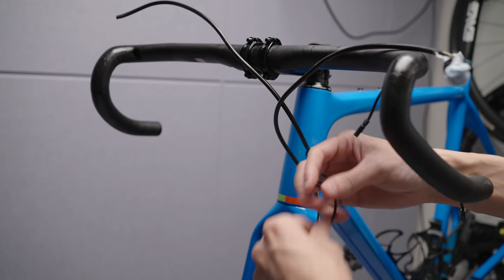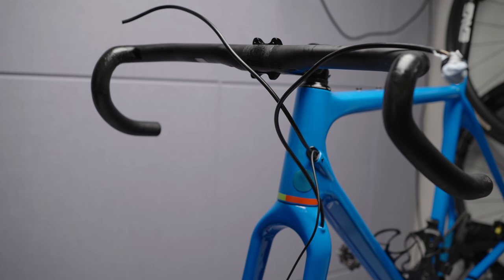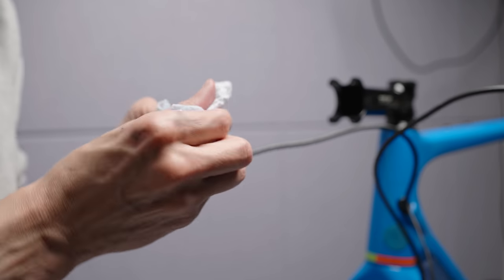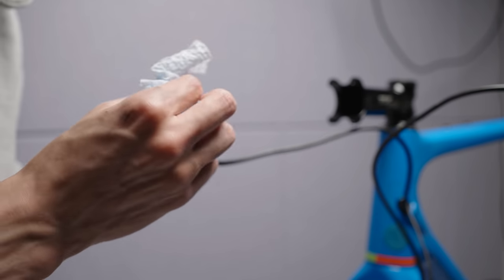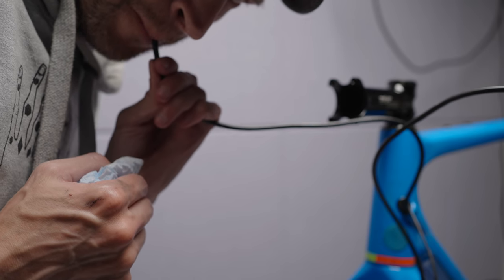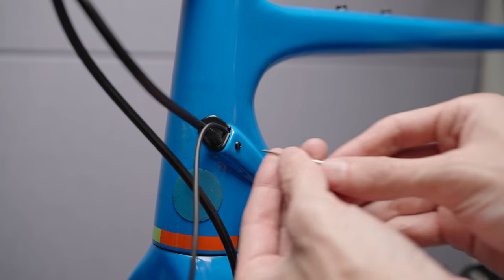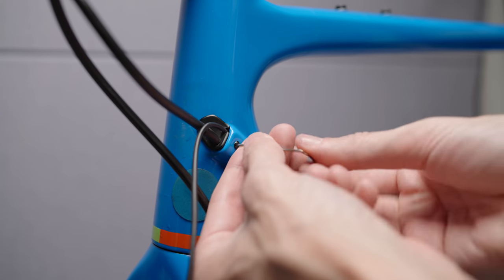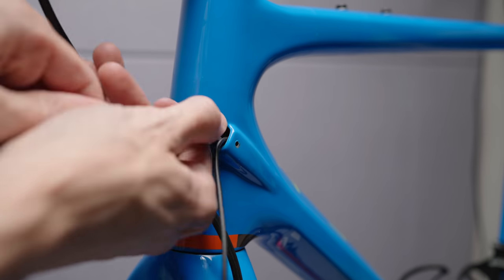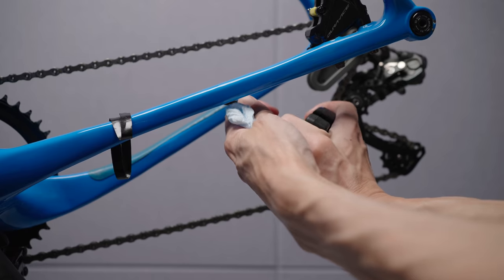I can say that I didn't need to replace the hose on the front — I had plenty of length to spare there, especially since the new bars are not internally routed. With the bars off it was time to see if I could swap that rear hose. A quick blow to get all the brake fluid out. You probably shouldn't do this if you're on SRAM with the DOT fluid. Then I removed the hose port guide and the front was ready.